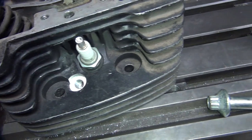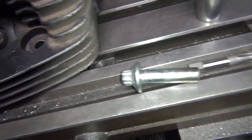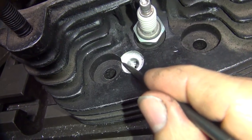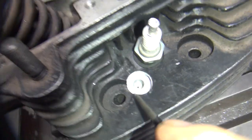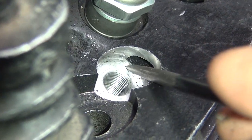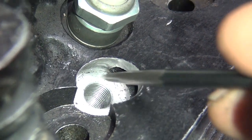So right now I clean this up — that nice even spot face made it nice and pretty. I cut it until right here, to the very end where that would just clean up. Over here there's a little bit of height right here, so I didn't have to go quite as far. Right there I can gain about 30 thou, but I cut at the minimum until I get my seat area in there — that's all I need.